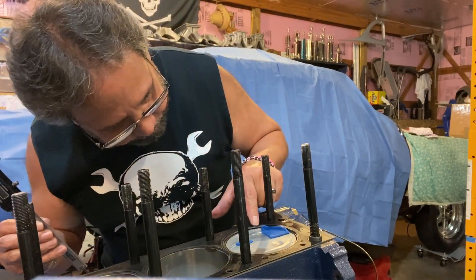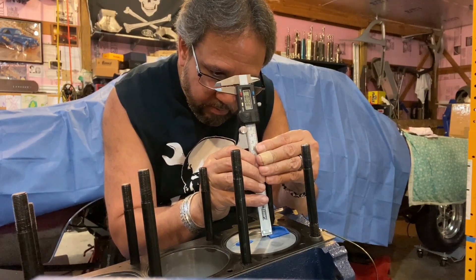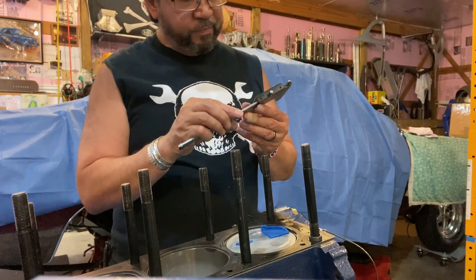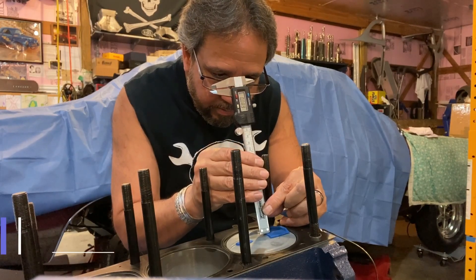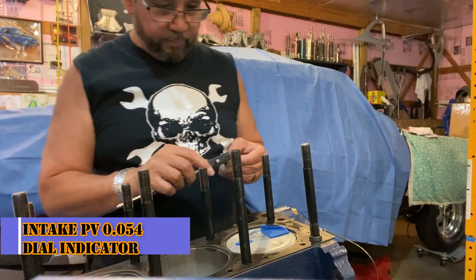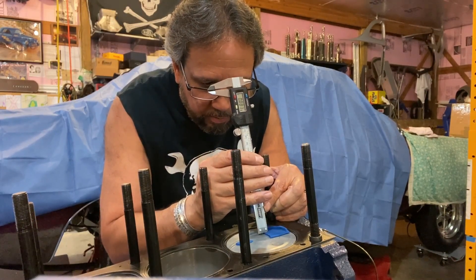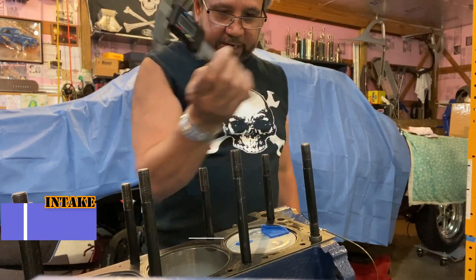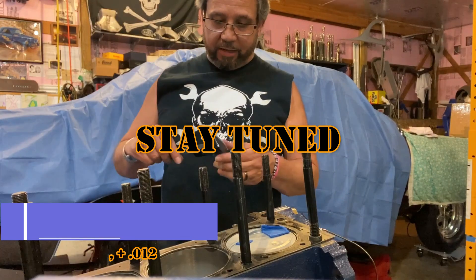Let's try this intake. It looks pretty close here — we'll go way out to the side, up to the edge. I just left barely a mark on that. Eighty thousandths right there. Measure it again in the mid aspect — seventy-six thousandths. We'll go right to the edge — seventy-nine thousandths. Pretty damn close. Clay with no lash compared to dial indicator with no lash — pretty close.